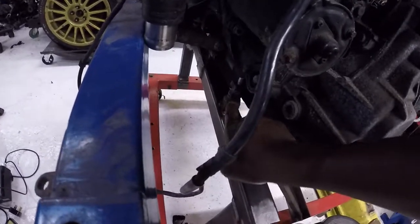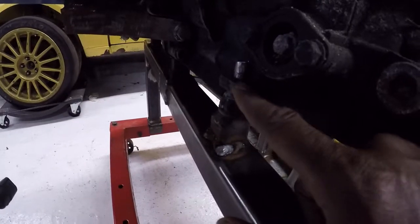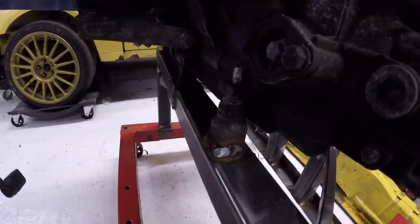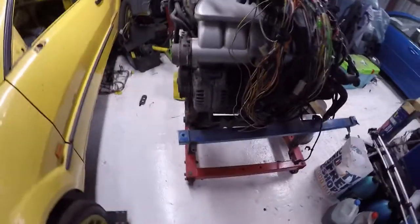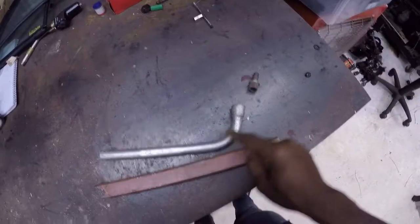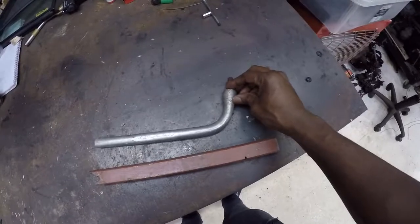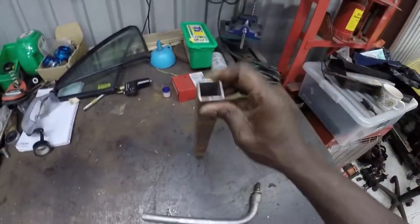To make these little pickup bits which come up through different points of the engine and gearbox — I'm assuming they're the factory cradle positions — I just used some box section steel. I cut up a wheel brace and used some wheel nuts. I took a wheel brace, cut the end off, and welded a wheel bolt inside, welded around the edge. Then I took that whole assembly and stuck it into 20mm box section, welded around that.